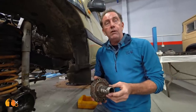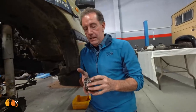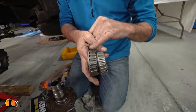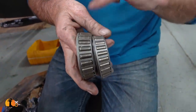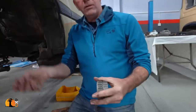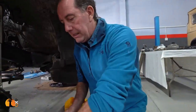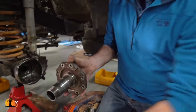I want people to check bearings more often, and what we're doing here is replacing your bearings. Bearings aren't particularly expensive, and I'd just go ahead and spend the money to change them. If I look at these bearings, you can see a brown tinge on the rollers — that brown is a sign of heat, so the lubrication has broken down, meaning the grease is either contaminated or there's too little grease in there, and this has run hot. So they start wearing, and then on the stub axle where these sit, you've got the surface where this bearing has to slide on.